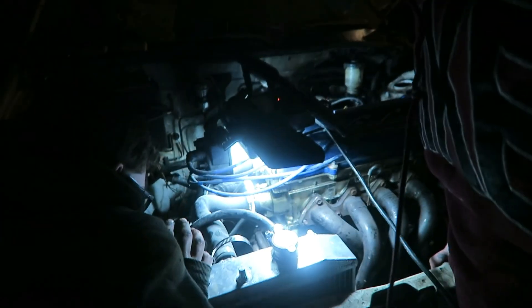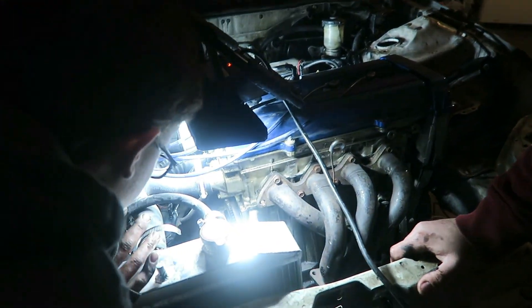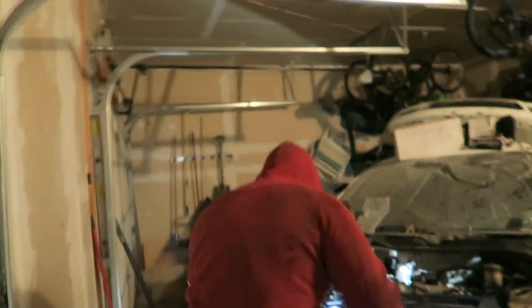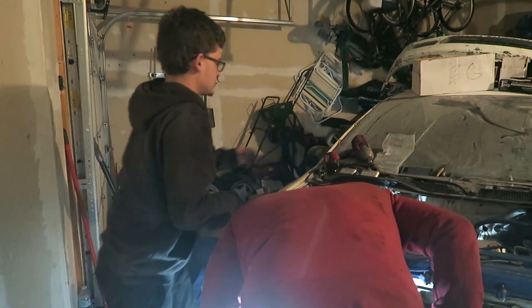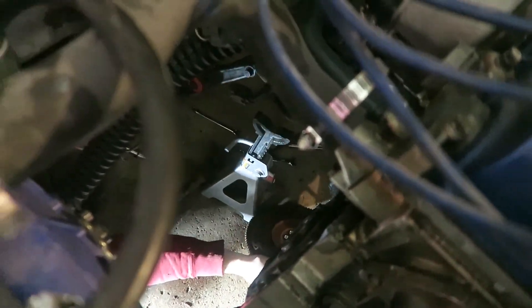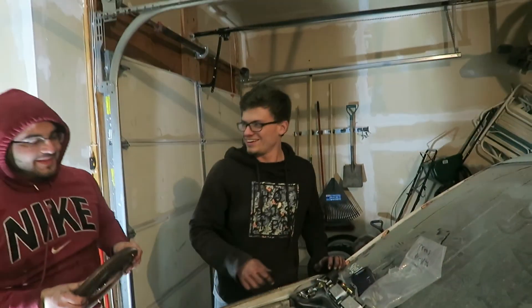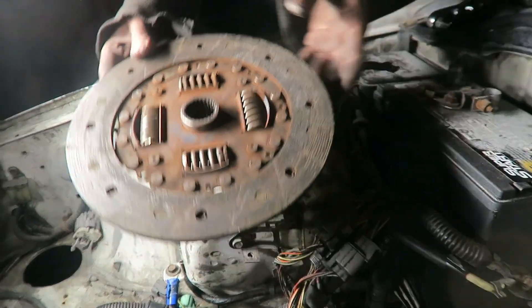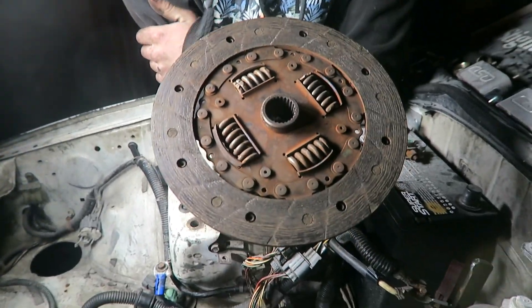Right now let's take a look and see what is actually broken. We've got to take out the clutch. What if it just rusted shut, like seized shut? Look how rusty it is. I'm going to have Rod turn the flywheel while I use the Uga Dugga to take out the flywheel bolts. When we install this clutch, we are going to make sure we torque our flywheel bolts down. Rod is taking out the flywheel bolts — the last flywheel bolt.